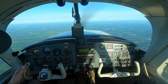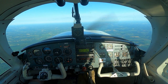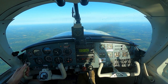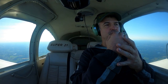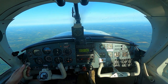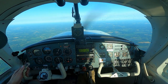The main thing is that your engine runs much more efficiently at wide open throttle, or the more open the throttle is, the more efficient your engine runs. That's why smaller engines in cars get better fuel economy than larger engines. It's because they're usually running more open throttles during their cruise power settings. The reason is, when the piston moves downward to suck in the air with a wide open throttle, it's not sucking against anything, so the air moves in very freely. Well, it's actually sucking against the air filter, but not against the closed throttle blade, and the closed throttle blade will suck a lot of energy out of that piston moving downward.